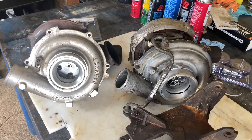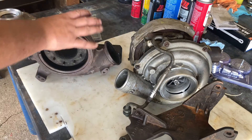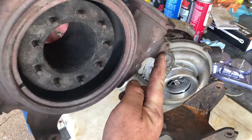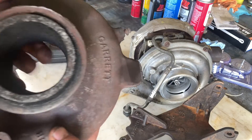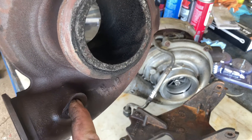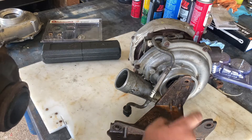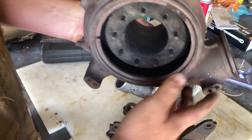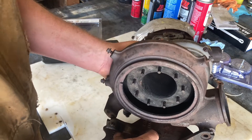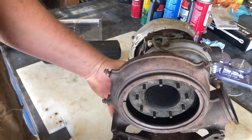On a 2003, the mounting points are in the front of the turbo — this is on the passenger side, that's the driver's side. On the reverse, and this is where the difference is, it actually has this bolt going into the turbo. You can see the three mounting holes here on the pedestal, and these little alignment tabs that help you align the turbo when you're putting it in the truck. It bolts in just like that.